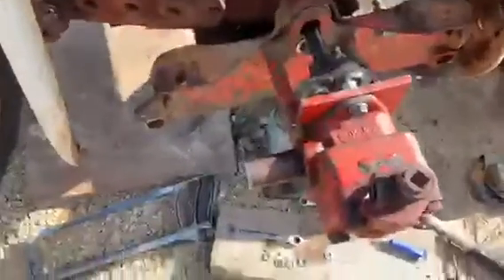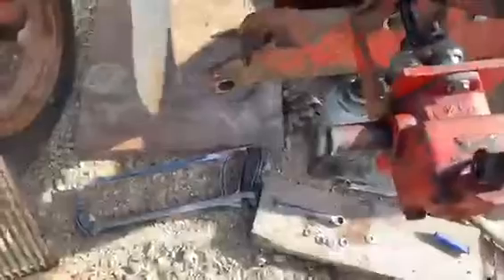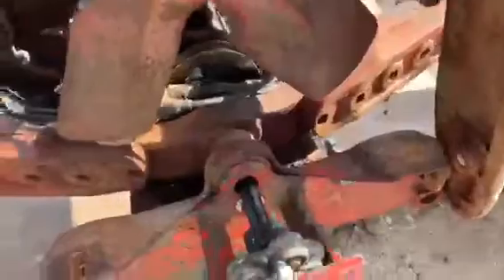Put a bottle jack there just to hold it in place, then tighten it down once you're good and drill your two holes. Make sure you have that first bolt tightened down before you drill anything — before you drill, cut, or do anything, make sure you have it all mocked up where you want it and make sure it's going to work right. Don't go too fast — if you're anything like me, something might catch on fire, like what happened when I rushed my truck.